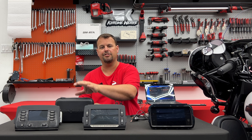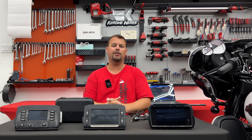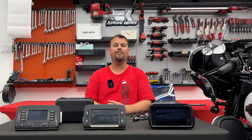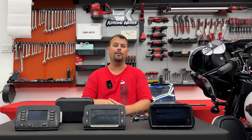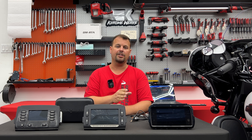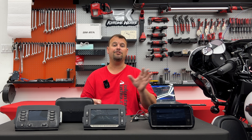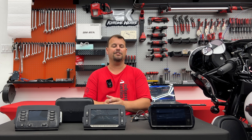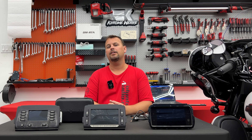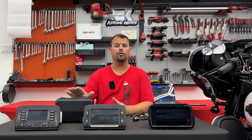In a later video, I'm going to show you how to go into your radio's service menu and pull your EQ.BIN file. This file tells you what flash is currently in the radio, and some of you that have a factory Boom Audio system do not need to flash your radio to upgrade your amplifier. I'll give you all those codes to look up to see when you don't have to flash it. Every other scenario of replacing the stock audio system and adding an aftermarket amplifier is going to need a flash of some sort done with a Techno Research tool.